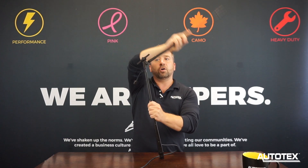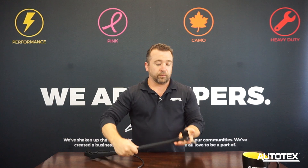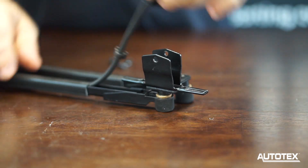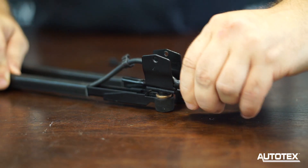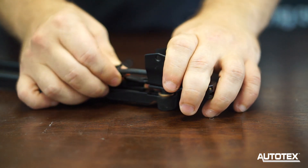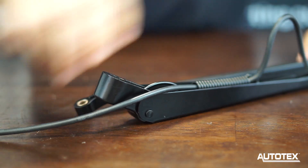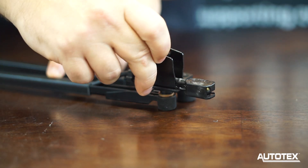We take the small arm and just rotate it right over the top. See that? Now we are all set for the passenger side. We'll reattach the washer kit — it'll snap right back on top. Reattach the grommet. Now we've got everything reattached, and we'll also pull down on the tubing to tighten up the rest of the tubing.